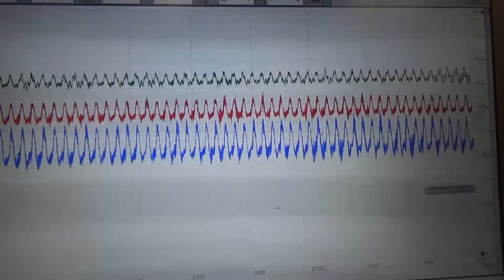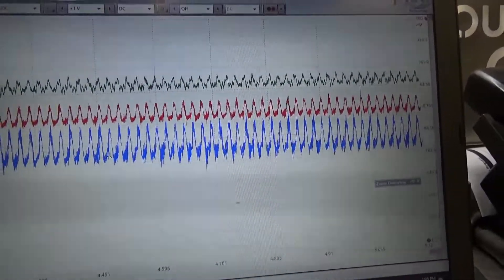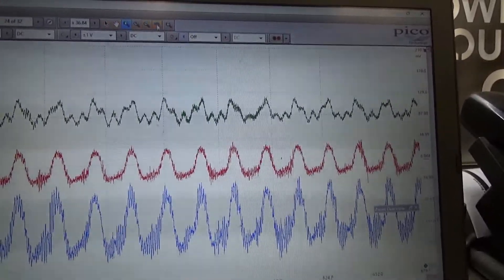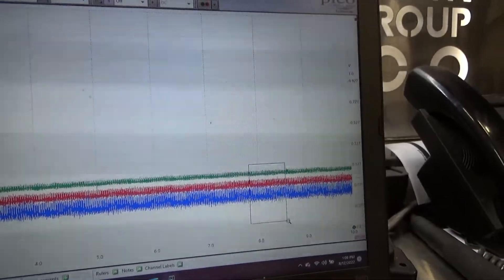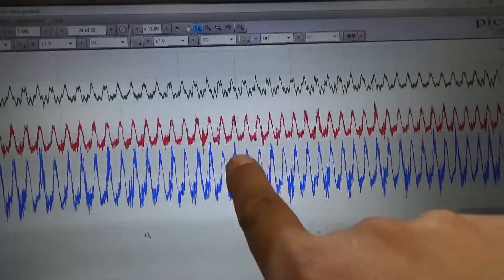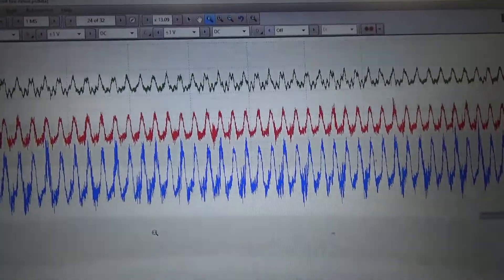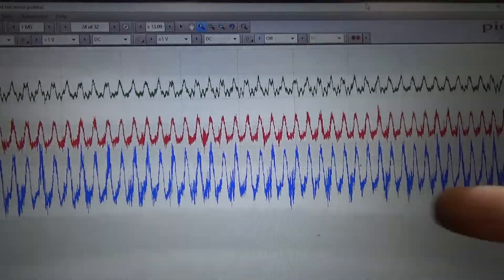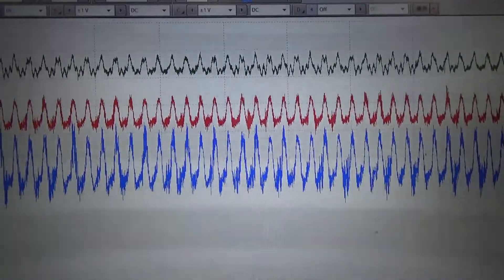You can see there, compared to our red trace, it's much noisier on the blue. I was comparing each area to find where the most obvious noise is. For sure, that's coming from the right front knuckle area.